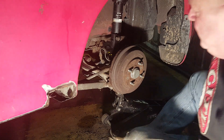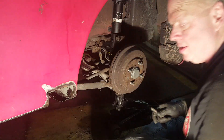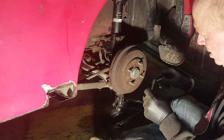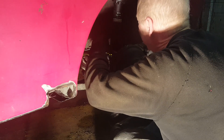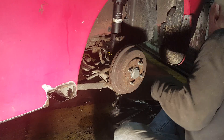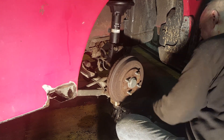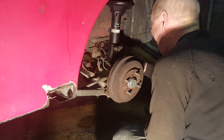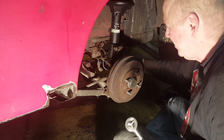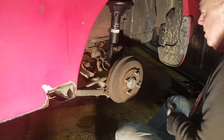What I was able to do was use a piece of 2x3 that fit up in the spot I needed — I was able to get the strut compressed while shoving the knuckle/spindle in between the flanges. I got one bolt in, second bolt in, all good. Now we can put the nuts on the bolts — they're all cleaned up — and then use 17mm with a wrench holding the bolt head.